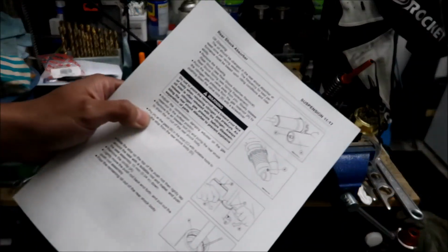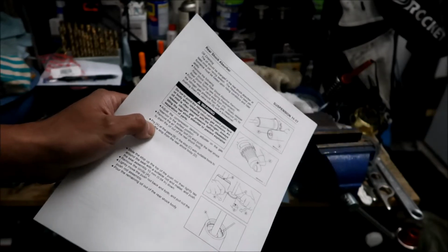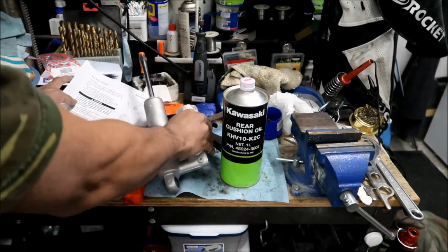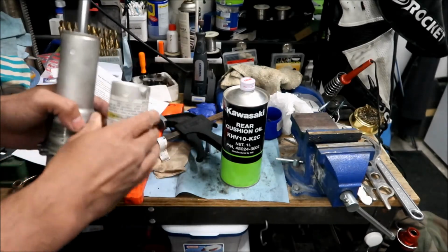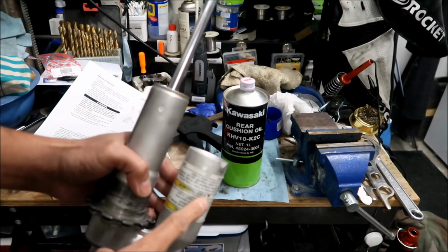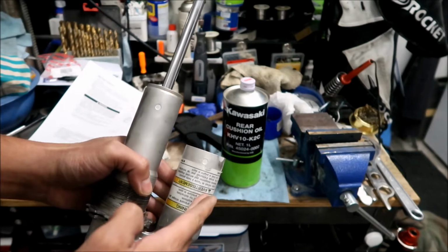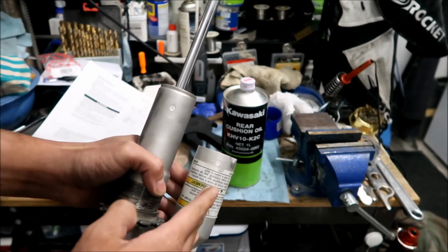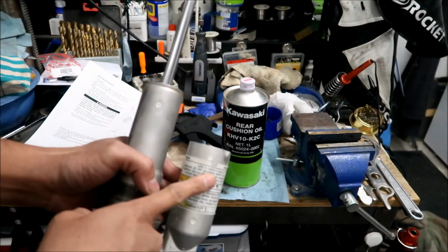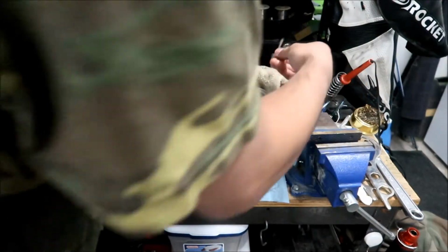Okay, and then point the reservoir away from you and slowly release the nitrogen gas, okay? So this bladder here, the bladder that's inside here, we're going to take it out. You guys will get to take a look at it. But the bladder in here has 142 psi when it's properly inflated, of nitrogen, okay? So you do not want to open this up while this is charged, okay? You absolutely do not want to do that. So that is Hades Omega's little disclaimer there, okay?